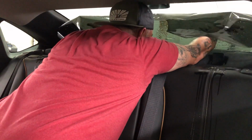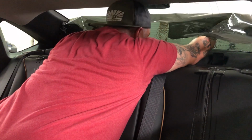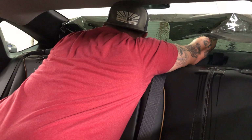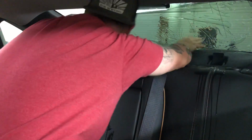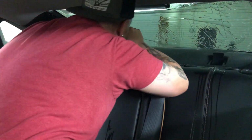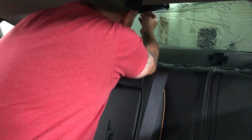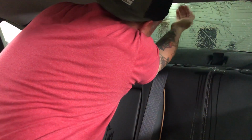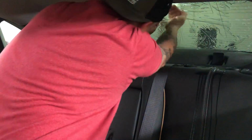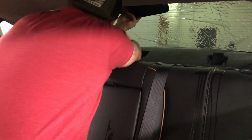So once I know I'm getting to the end, and I can see the daylight getting covered up, all right, I've covered. Now what I do is I look on the sides. If I'm covering on the sides, this is what I do. I haven't rolled it up yet and touched this cover. So what I'm gonna do is I'm gonna come up under here, pull that cover down. I'm holding it down, just doing a tuck. Tuck it up underneath there, roll it up, finesse. Don't force it.